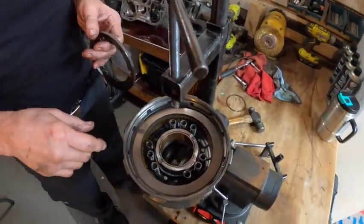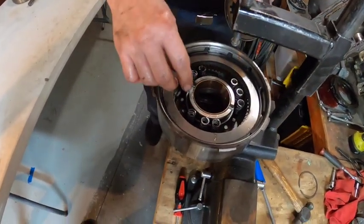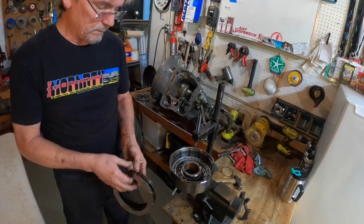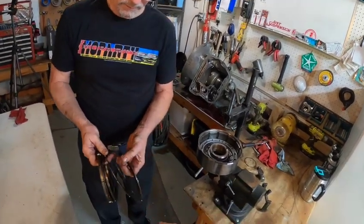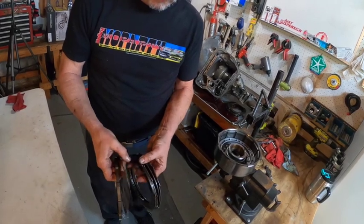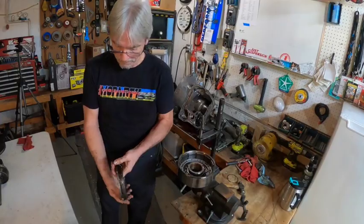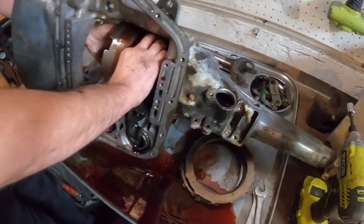On the rear drum, Jim finds someone already left some springs out — the way he builds them too. Leaving one spring in and omitting two makes the piston jump out quicker, giving better feel in third gear. This drum is the second gear / reverse drum: you hold it for second, drive it in reverse and third. There are four clutches and four steels. The thrust plate looks good — any discoloration can be addressed by flipping it to use the other side. The one-way roller clutch is demonstrated spinning freely in one direction but locking in the other — that's first gear.